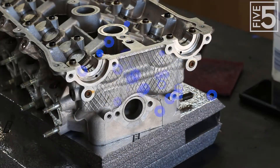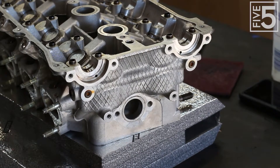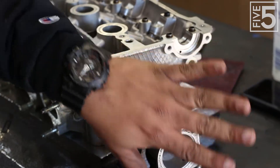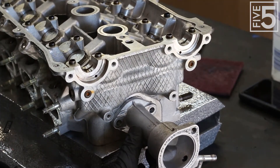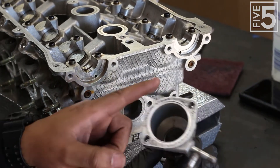Today I am finally ready to put the cylinder head onto my engine block. I have already cleaned it, added new valve stem seals, cleaned the valves, and cleaned the combustion chambers — everything is ready to go. But there are a couple of pieces I want to add before putting it on the engine, because it makes the installation process easier. The first thing we're going to work on is this front water outlet. Normally this is your thermostat housing — it fits here like so, the thermostat goes in here, and then the water outlet goes to your radiator. My car will be running a coolant reroute, so I have to make some changes. First, I removed the studs on here.